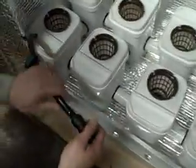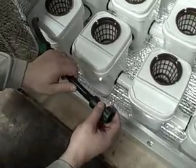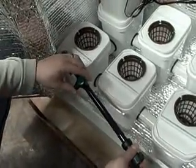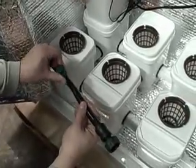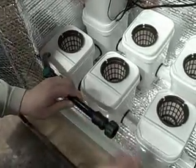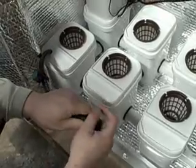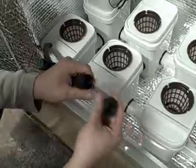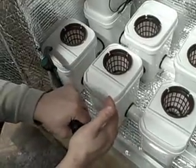Namely, the first thing that we'll talk about is an automatic fill and drain system. What we have here with this tube, there's a quick valve here. When the system's normally operating, if you want to drain the system, you just open this valve and water will come shooting out of this end. Now this is actually a garden hose attachment that you can lock in or take right off. And this screws onto your garden hose and basically pops right in here to lock.